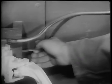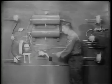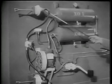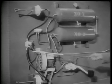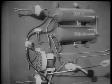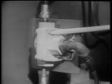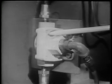You can't see the air escape when the brake is released, but a spoonful of powder held under the exhaust valve shows what happens. The front brake chambers are so far from the brake valve that the brakes will drag while the air is escaping through this long route. To prevent this drag, a quick release valve is used. This valve is located close to the front brake chambers and allows the air to escape much faster.